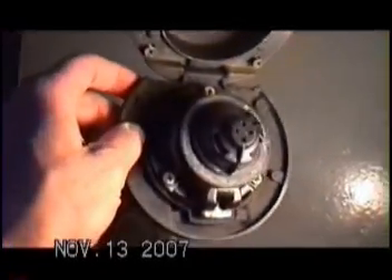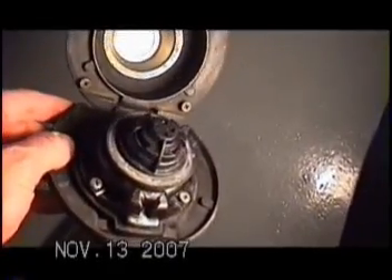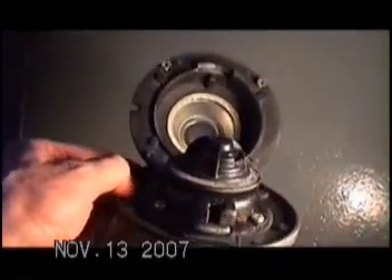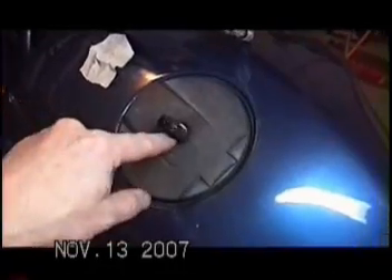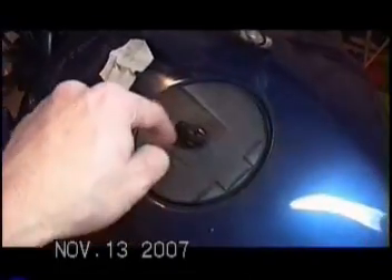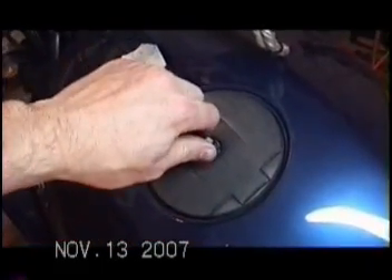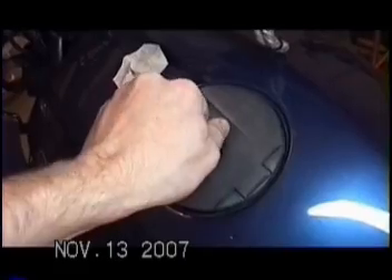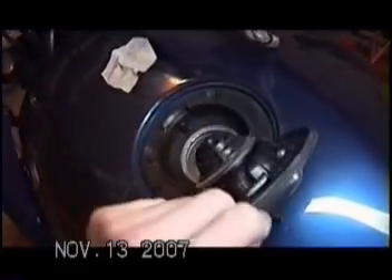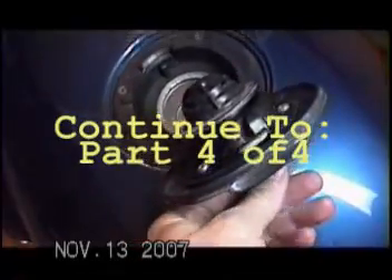Plan to take a lot of digital pictures — really take your time and take a picture of every single part you remove so it goes back together easily. Don't try to fix a sticking mechanism by shooting graphite into it, because that does absolutely nothing. Instead, go in, disassemble it, and put some grease in there. You'll hear a click and it opens right up. To make it easier on the sliding mechanism, put pressure on it and then turn the key.